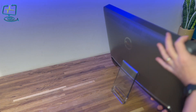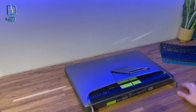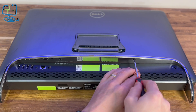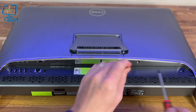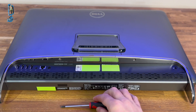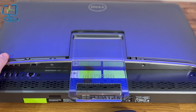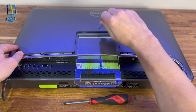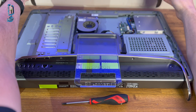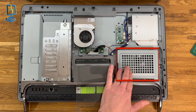We start off by flipping the Dell 2310 over onto its front. On this particular machine there are two screws on the underside of the back — one here and one there — and we just need to release them. I'll speed sections of this video up to keep the overall length down. We take the two screws out and release the back cover by pushing away from the screw holes and it pops off. It's just slid under some catches.